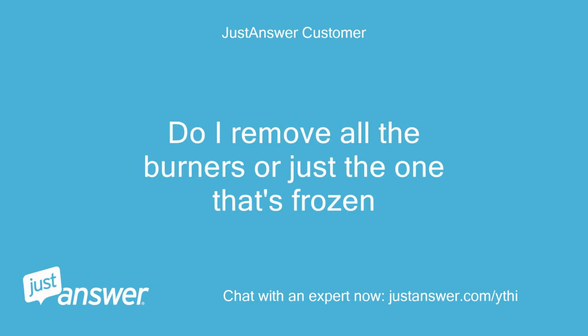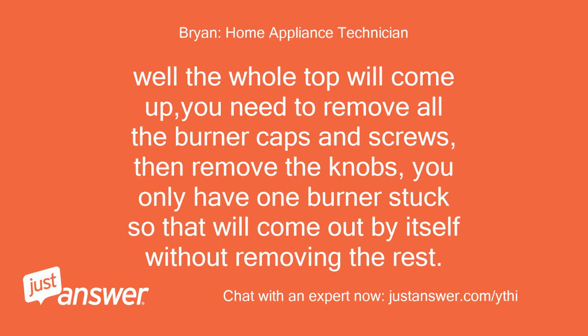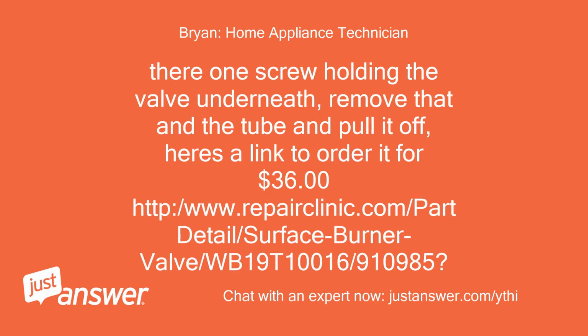Do I remove all the burners or just the one that's frozen? Well, the whole top will come up. You need to remove all the burner caps and screws, then remove the knobs. You only have one burner stuck, so that will come out by itself without removing the rest. There's one screw holding the valve underneath. Remove that and the tube and pull it off.